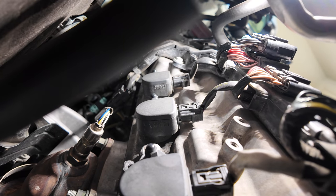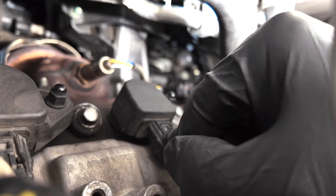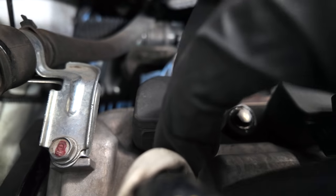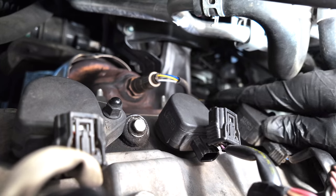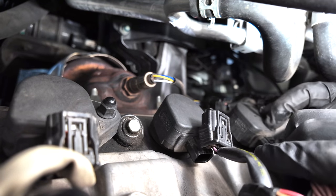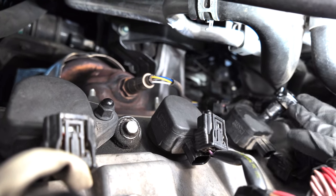Now we repeat this entire process one more time on the back side. For this part, you have to rely on how these components feel. Start by disconnecting the coil terminal. Be patient here. Don't attempt to pull the terminal by the cable. Sometimes using two hands can be helpful. Obviously, the camera is making this section look like it's accessible, but in reality it's not. I thought it was important to show you this back section to have a full view of the entire process, since many other YouTube videos don't show it.